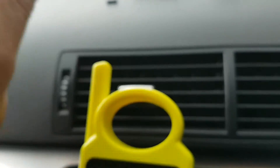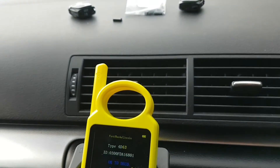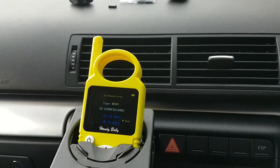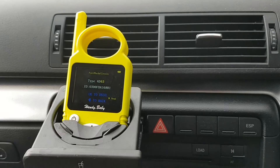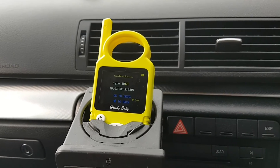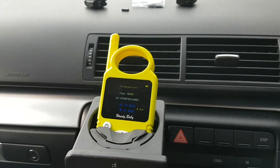So this chip is a one-for-one match for the chip in this key. We're going to pop this chip into the new remote — into that space there — and that will allow the car to start. Then you program the remote and cut the key. The whole process, including cutting the key, programming the remote, and cloning the chip, can be done within 10 minutes easily. It's a really good tool — it does the 4D chips, the 46, and some ID48. If none of this means anything, we do full training courses on the whole range of key programming, key cloning, eprogging, key cutting, lock picking, and everything else. If you want to check out more about the courses or the tools, including this one that we sell, check out obdcompany.co.uk.